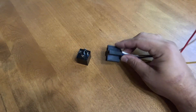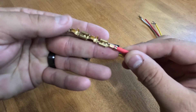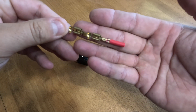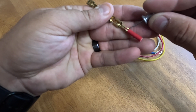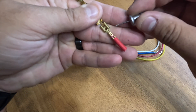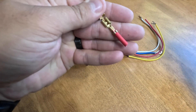In order to remove these pins you have to understand how they work. Here are some raw, unterminated pins — one of them is actually terminated. You can see there's a double crimp: on one side you have the insulation grip, which is the strain relief that bites into the insulation to prevent it from pulling back. The second portion is for the actual crimp itself — that's what clamps onto the wire.